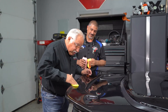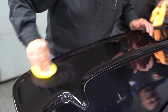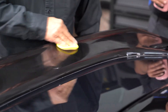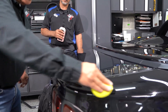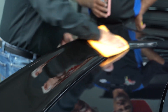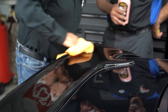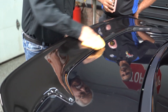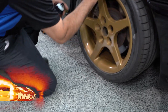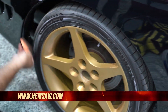So what we're doing right now is just putting the layer of wax on. You're a real good assistant, Sam. How long are you going to let that sit before you take it off? I'm going to put a nice coat on it, then probably let it set three to five minutes, touch it, make sure it's nice and dry. You don't want to try to pull it off when it's too wet. We'll use a nice clean rag. Make sure, guys, when you're setting your rags down, you know where you're setting them — I've seen more than one person throw it on the ground, pick up a little rock into it, start wiping, and suddenly scratch their paint real bad. Then when you're putting tire shine on, I like to put it on at night so it's dry by morning and won't splatter all over the side of the car. Thank you to Doug for letting me watch him do such a great job making the Saleen look beautiful.